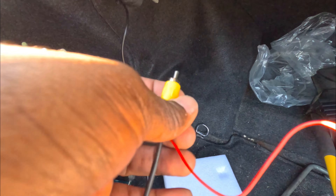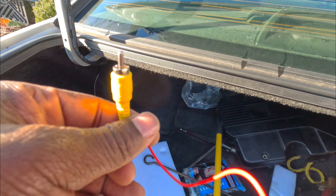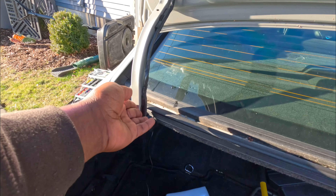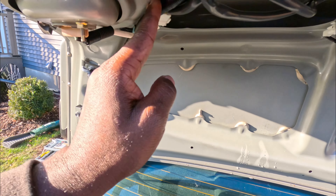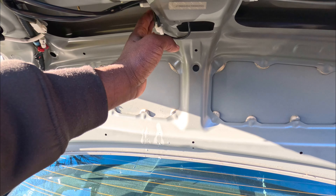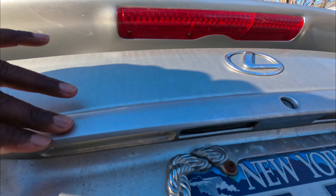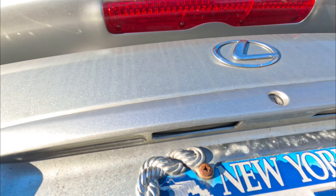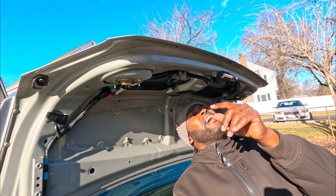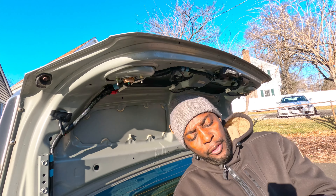This is my cable — the backup light is right here, but this part's gotta be run all the way up and follow this line, coming off right in the middle up here. First thing, we gotta take off this trim right here so I can properly mount the camera on it. I can see there's a 10mm and a couple clips, so let me take the 10s out first. I should be able to push the clip up.